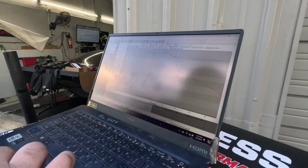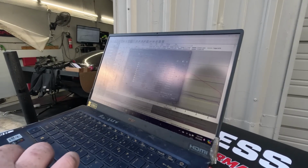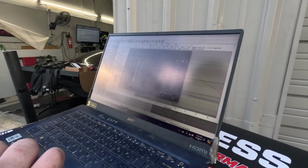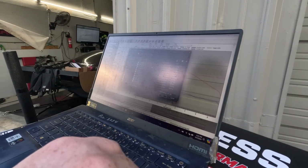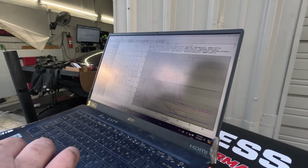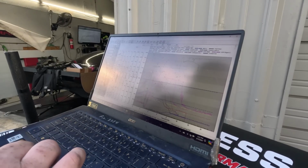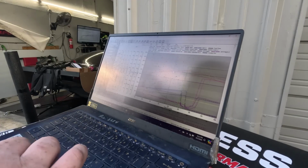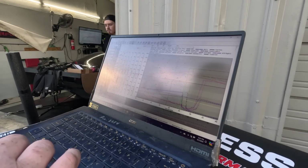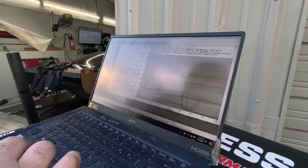Now let's look at our run from the other day. We're going to look at fueling and see if maybe that was it. Let's see what date we have. Last Monday the 2nd. So let's pull that. Did a really bad job saving my logs. All right, so we're going to lay the RPM plots on top of each other as much as I can here. So let's just take a look here, 6450 basically. And it's a pound of boost difference. And then same fueling, same pounds per hour delivery.